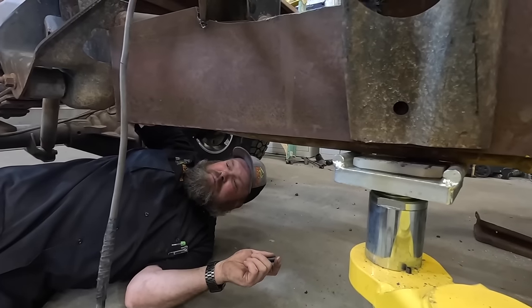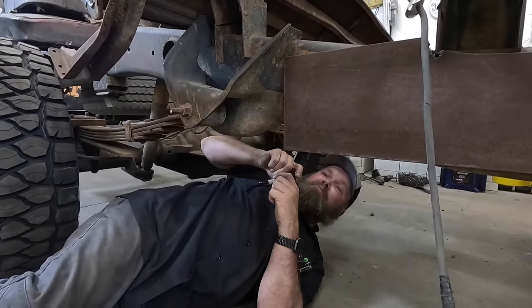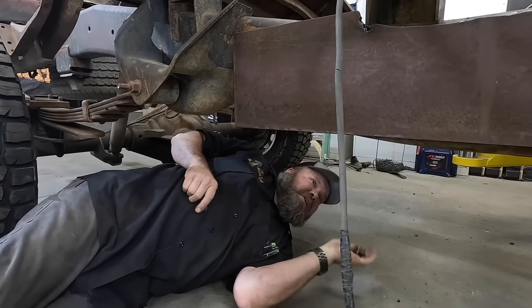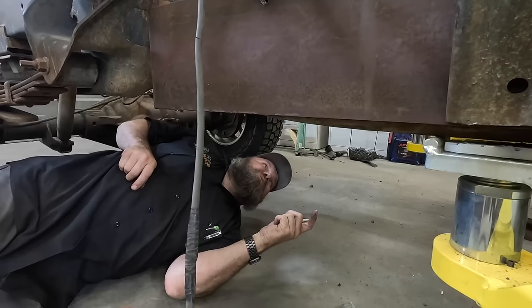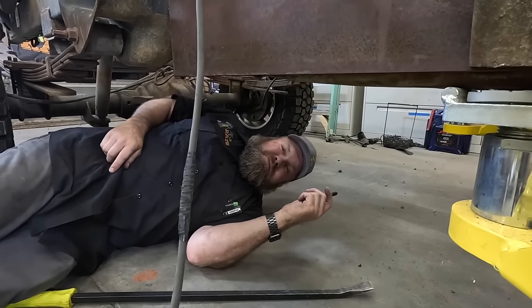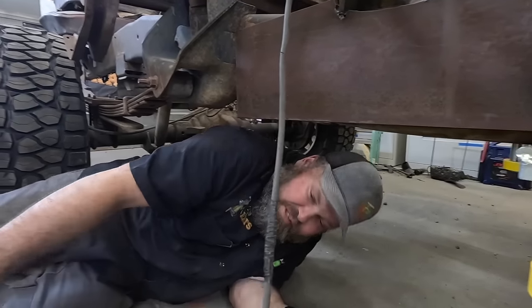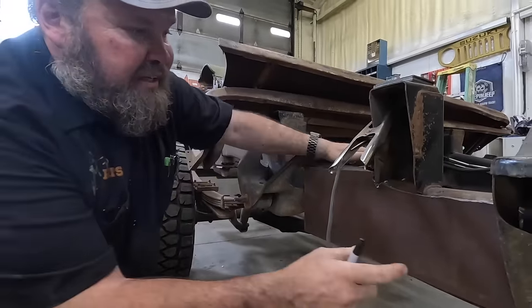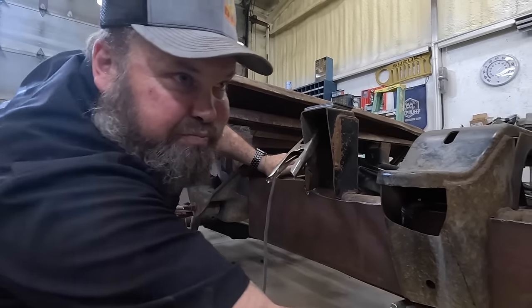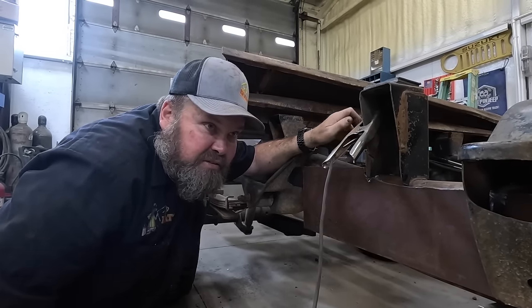We'll see if we can trim this off without completely messing it up. But that should be the whole frame. It should work. We just got to make two of these. The other side should be the same, minus a few little things. Then we got to put holes in it so we can plug weld it. We don't want it to flex and warp, so we'll cut holes down throughout. And then Sean will weld it in because I'm banned.